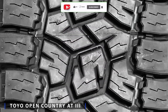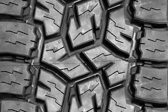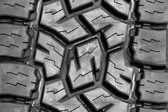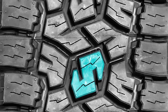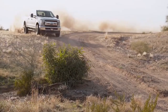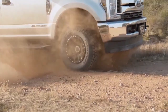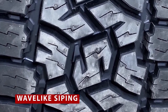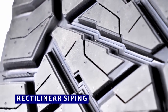On the Toyo AT3, however, the placement of the central blocks does not make any proper lateral grooves. The tire features bold S-shaped blocks surrounded by others with notches in them. These notches act as biting edges facing in all directions and provide grip from all directions. All blocks on the Toyo AT3 have 3D wave-like siping, while on the Nitto Ridge they are rectilinear.